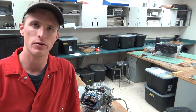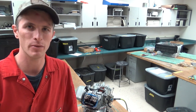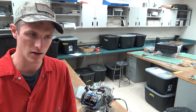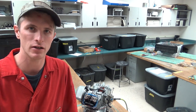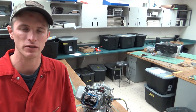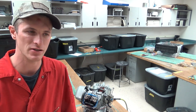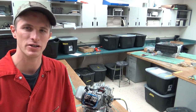There you go — that is how you remove the valve cover from your Honda engine. Sometimes it's easy, sometimes it's really difficult. I don't tend to bend up a lot of these if I do them that way. I actually took this one step further: on engines I work on, I install a valve cover gasket. You can't buy that part from Honda, so we designed it in AutoCAD and cut it out on our laser engraver next door. I keep about 100 of those in stock — probably a good product idea to sell. Makes my life easier so I don't have to open a fresh tube of silicone every time. Appreciate you watching — see you next time.